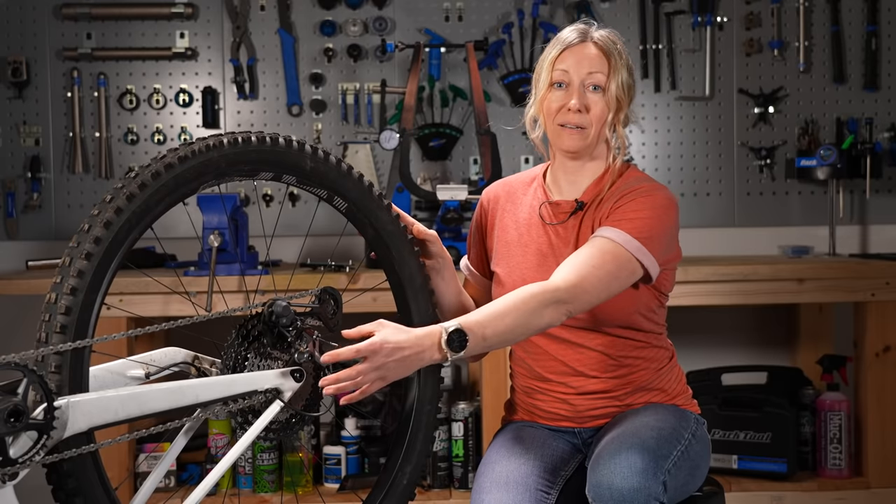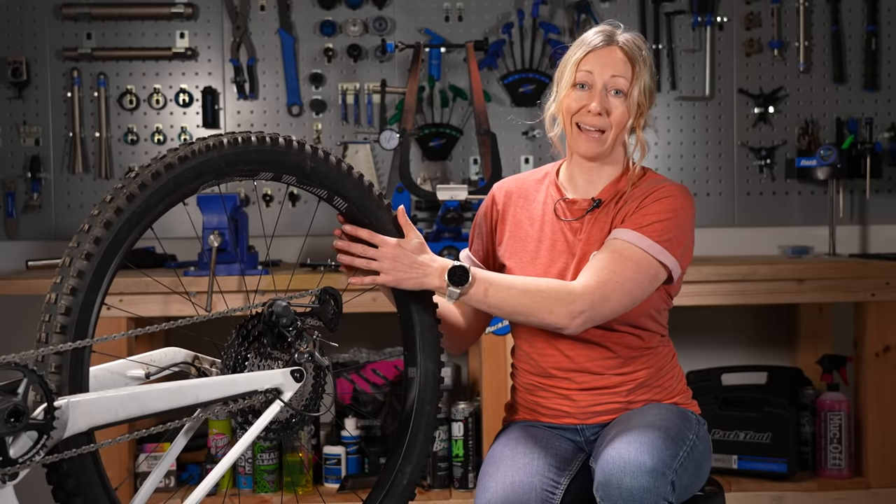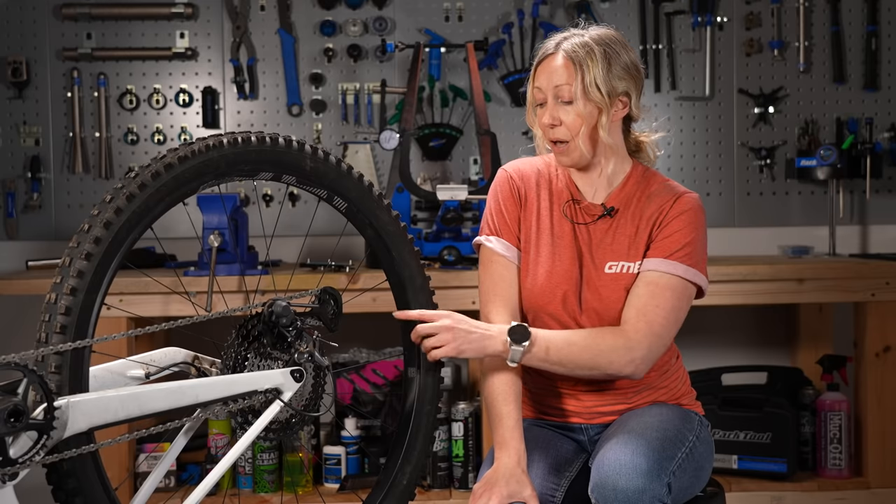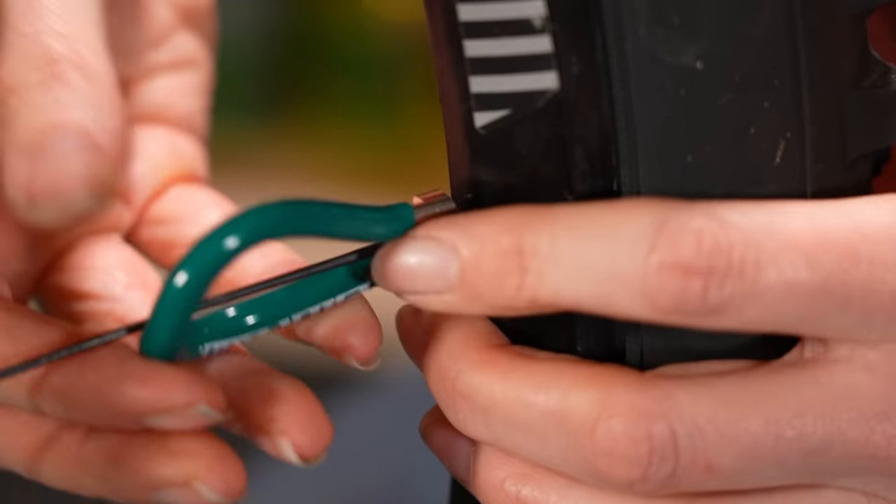This rim is suspended around the hub and is obviously attached by the spokes. Spokes will pull on the left-hand side and on the right-hand side, and an even tension will keep it in the center. If any of the tension is loosened on one side, the rim will start to pull towards the more tensioned side. So equally, if you lose tension in a couple of spokes, the rim will start to bend towards the tension side, and that's when we start seeing a wiggle in the rim or a buckle. What we need to do is tighten those back up to get it back into a straight line.